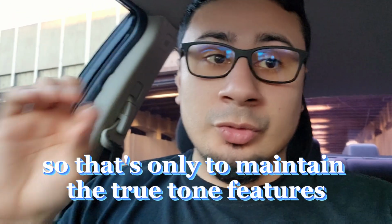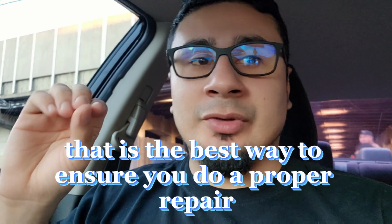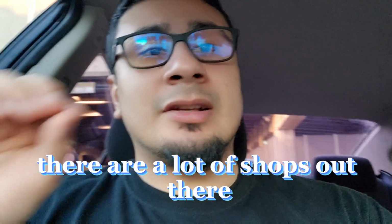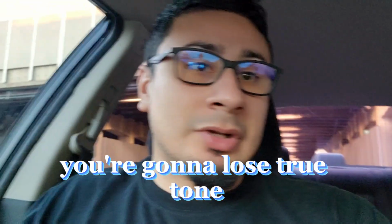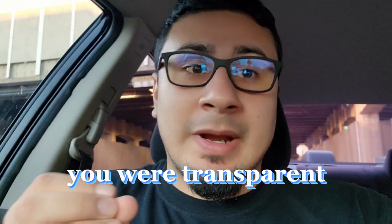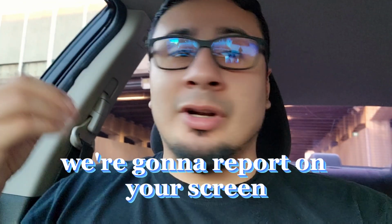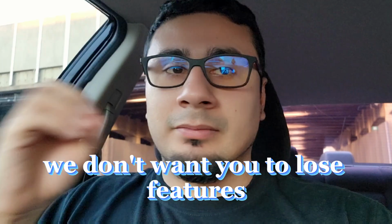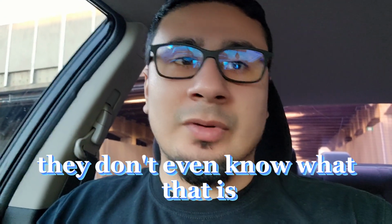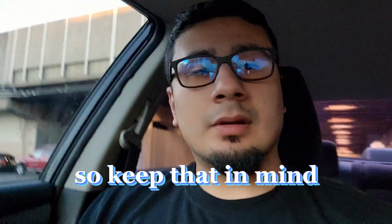So that's only to maintain the True Tone features. I highly recommend you look into it and you get a programmer, because that is the best way to ensure you do a proper repair. There are a lot of shops out there that do not do that, and I don't understand why you would do that to your customer, unless you're telling them, hey, listen, you're gonna lose True Tone, and if they're okay with that, you were transparent, that's awesome. But if you really want to do a proper repair, you want to say, hey, we're gonna reprogram your screen so your True Tone features are there. You paid a lot of money for this phone, we don't want you to lose features. Boom, done. 90% of the time, they don't even know what that is, but they will be grateful to hear that you're being very professional. So keep that in mind.